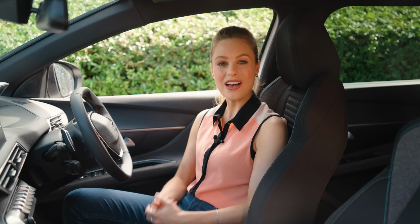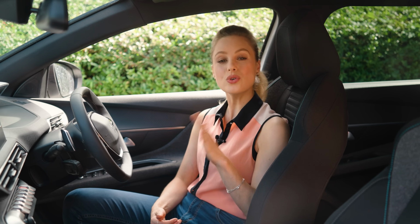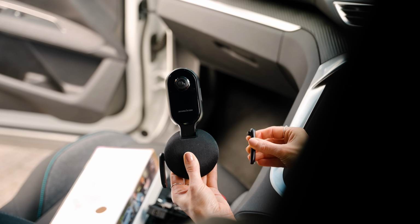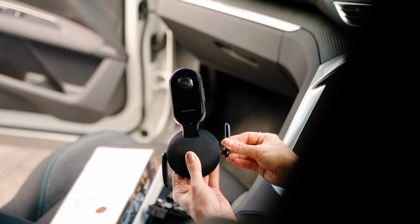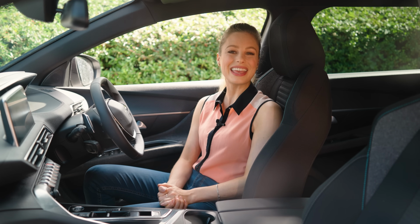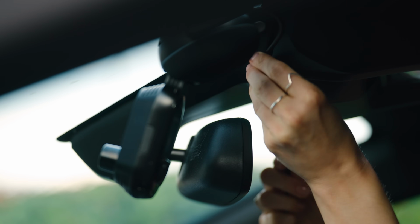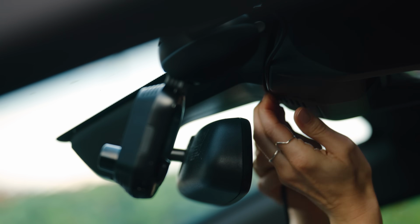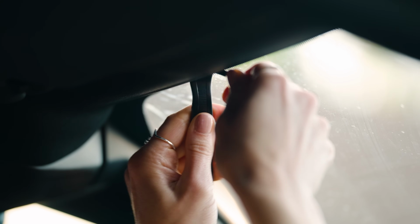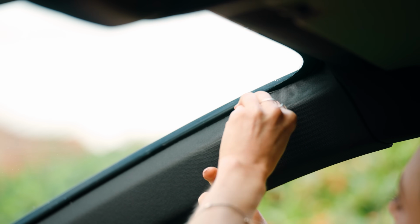The antennas on the side can also be adjusted according to your car's design. It can point up or down towards the dashboard. To change their direction, pull them out and reinsert them to face the desired direction. Now that the IQ is ready to go, you can begin tucking away the cables to make a neat install. We want to find a pathway from the front camera down so there's no slack on the cable. Starting at the IQ end, I'm going to tuck in the cable down by the side of the dashboard. This allows any spare cable to be hidden near the OBD port.